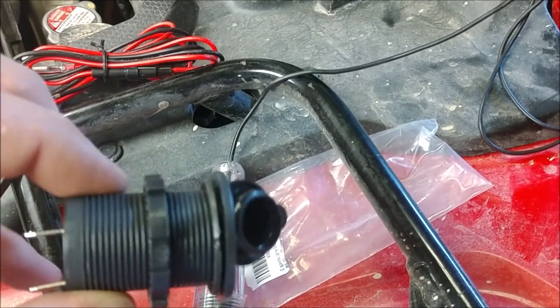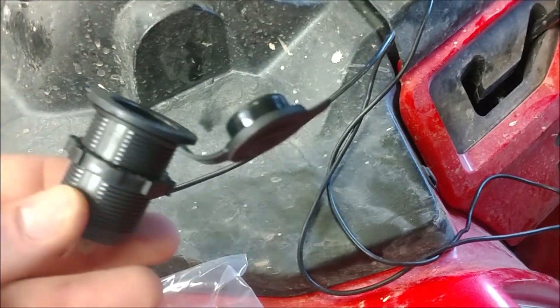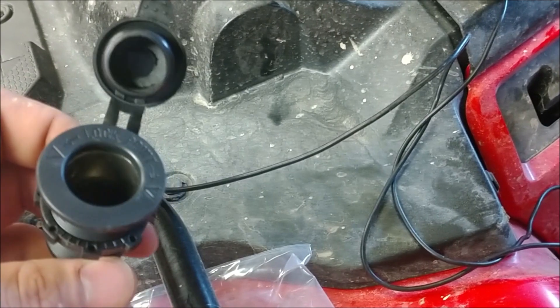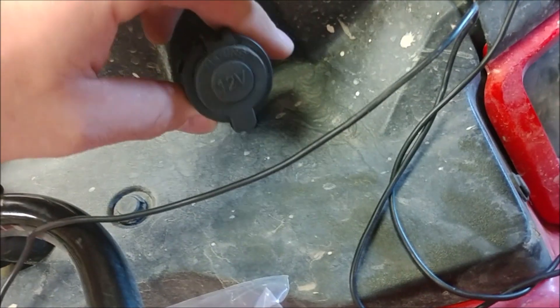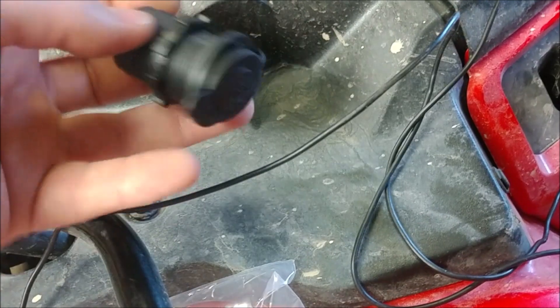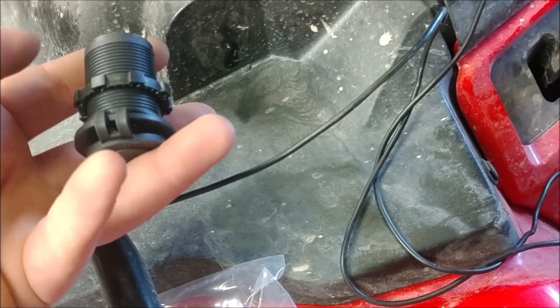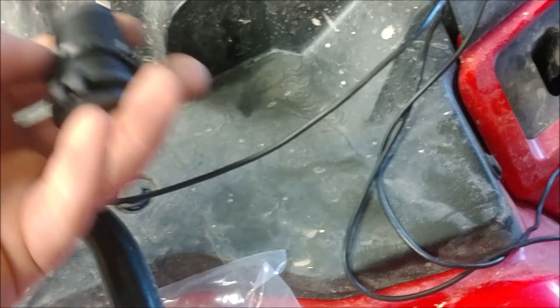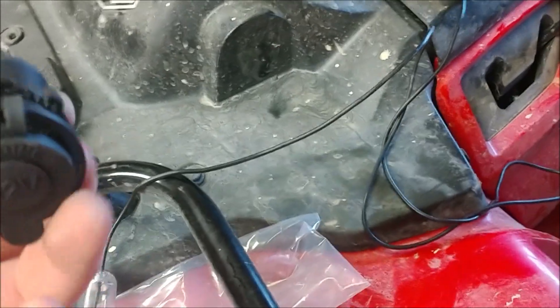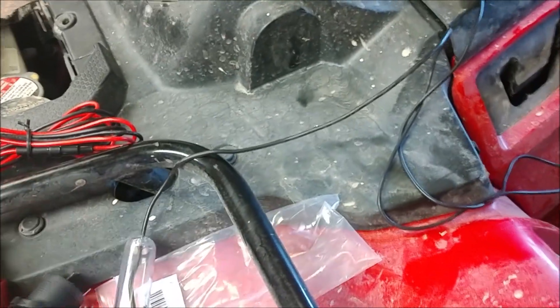The distance on each side to drill this hole is an inch and one-sixteenth. I don't know if it's listed on the product description, but I checked it — an inch and one-sixteenth. This is also a marine plug, and marine grade does not mean waterproof, it means water resistant. I can put the rubber cap over it and it'll seal once it goes on there. Once I tighten it all the way up it won't wiggle around, but I may also add some Teflon tape.